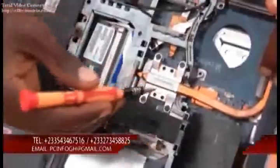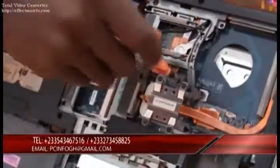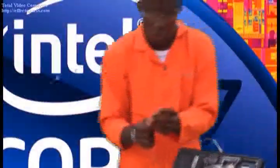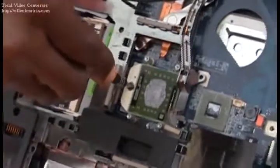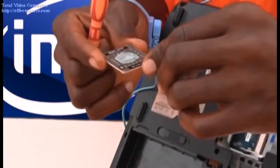Then our next step is followed by the removal of the heat sink. Here we have about four screws to enable us to remove the heat sink. Gradually, extremely easy, we take it out. We change the screwdriver and remove the screws from the processor socket. So we move it up — our processor. Down here we have the processor, an AMD Turion.